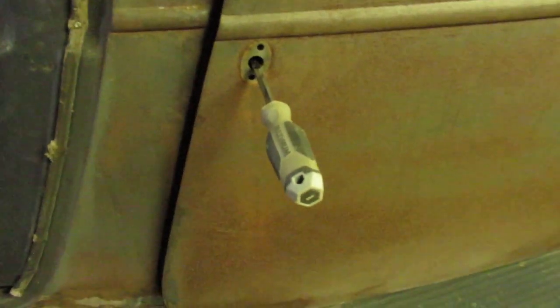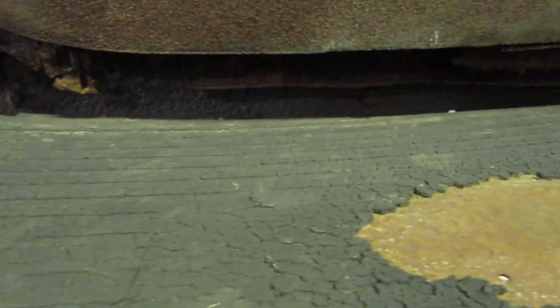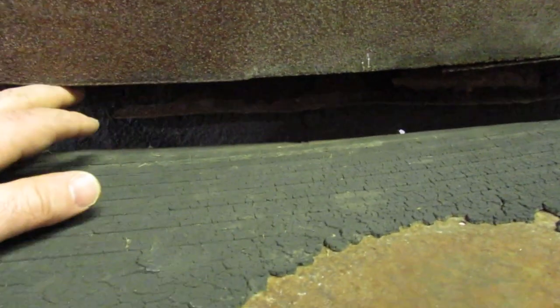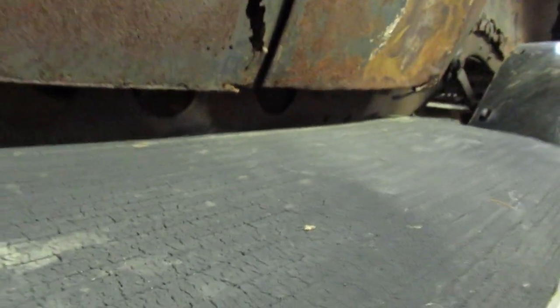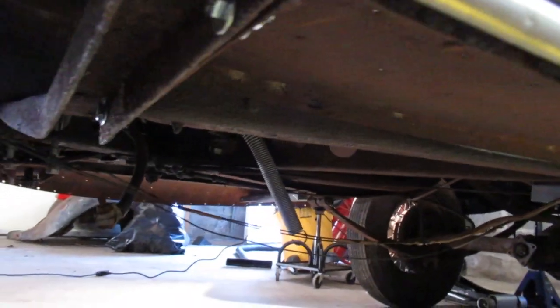This is my temporary door handle — it actually works pretty good and fits into the square nicely. Like I mentioned, it's about an inch and an eighth between the running board and the bottom of the door, and it is constant. When you mount this on, just make sure you follow it steady the whole way and decide whether you want the running board sitting at the bottom of the fasteners — which is probably where it's going to end up after you step on it a few times — or at the top.